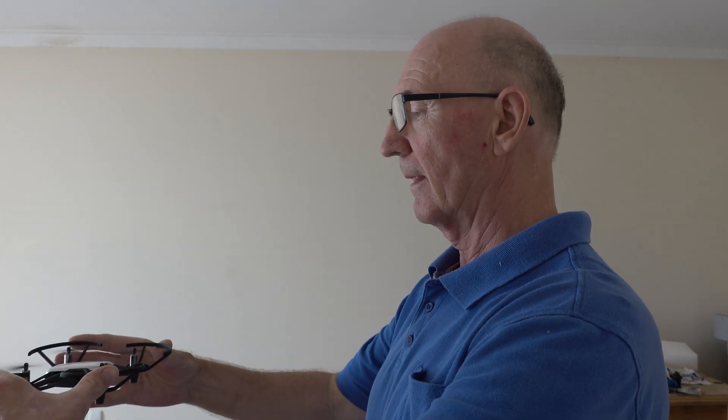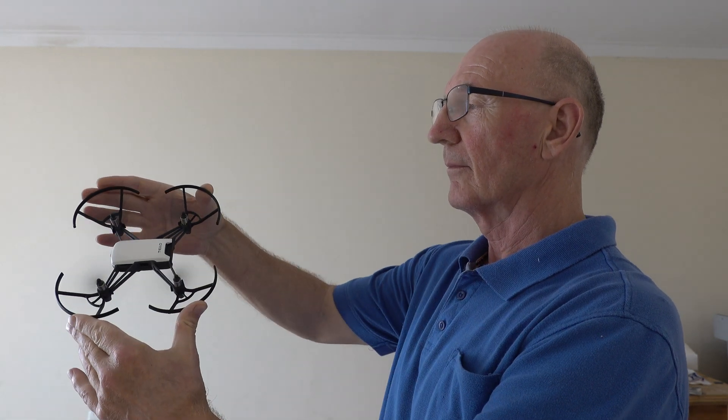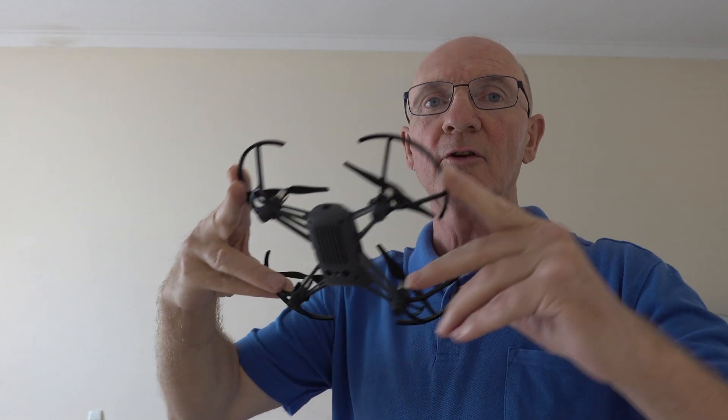It's got something called an optical flow system. It's got two sensors at the bottom — one is flashing red and one is black. One is sending and one is receiving — one is transmitting and one is receiving. It's transmitting to get a picture of the floor. Imagine it as a photograph — millions of photographs a second. And then it's receiving the picture. So it's keeping in memory a pattern on the floor so that it doesn't move, and by that way it remains incredibly still. Same as an optical mouse — it uses this optical flow technology.